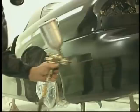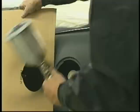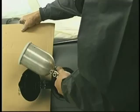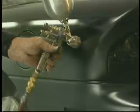Now, going around the gas area, we use a cardboard masker to just make sure we don't get excessive overspray on the outside. This is a good idea. And then make sure you get the black around the edge where that goes. And we'll proceed with this as we go through the Kameleon stages as well. All right, we're going through our walk now. And this is critical. Just take it nice and easy. Don't get upset. Remember that these panels change a little bit. The quarter panel's a little wider than the front fender, and so keep that in consideration when you're doing it.